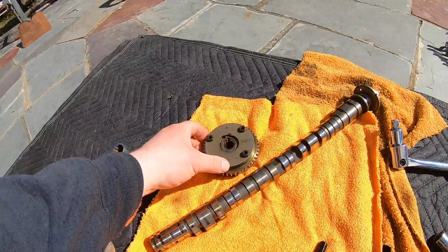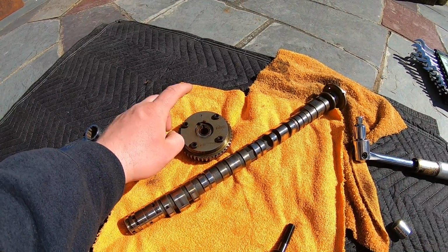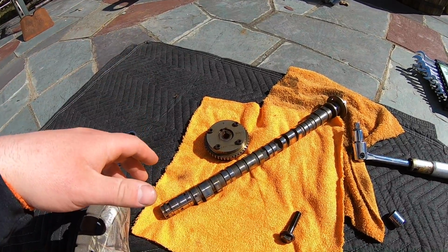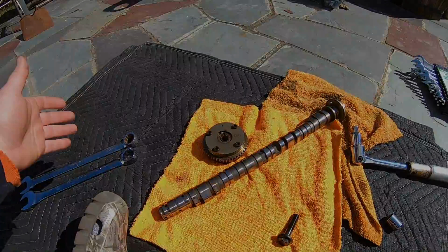You guys want to know why I'm going 50-degree VTC, there's a reason. And let alone if you run the RBC intake manifold versus the RBB manifold, you're gonna sacrifice, I'm gonna probably still lose torque anyways. But at least with the 50 degree over this 25 degree VTC, I can tune it more so I can pick up potential more power mid-range or lower VTC down.